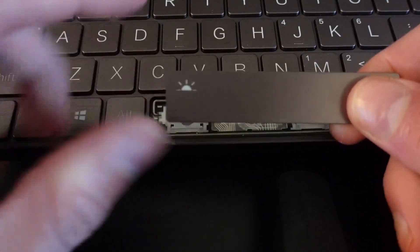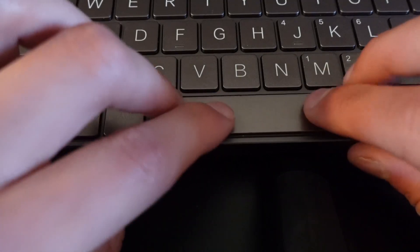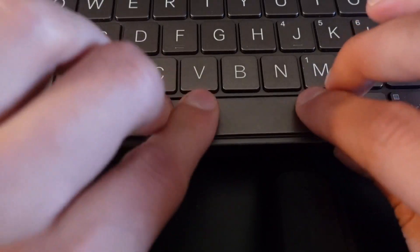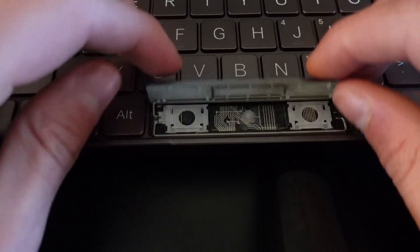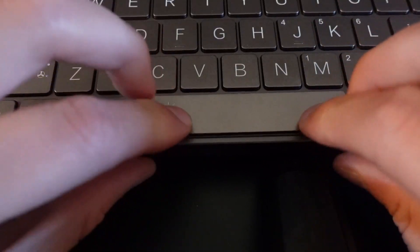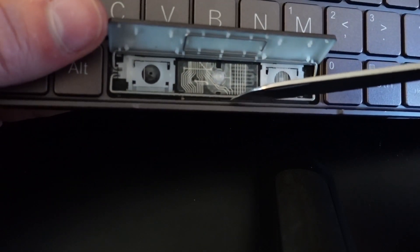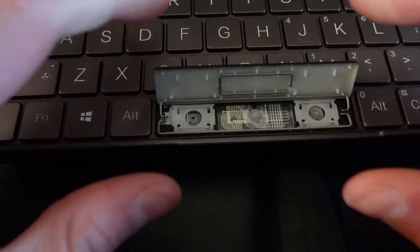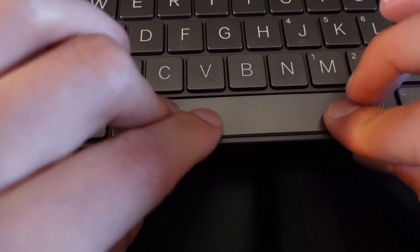Attaching the bar is quite simple — just put it in place and gently press from the top. For me, the frontal part of the spacebar does not snap in properly, and that is because the metal is not in place properly. Make sure that the metal is pushed towards the center as far as possible. Once that is done, reassembling the spacebar is no problem.